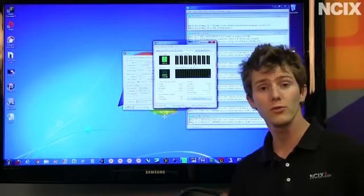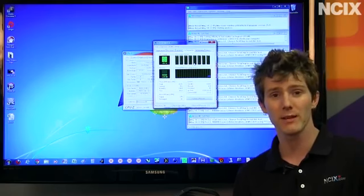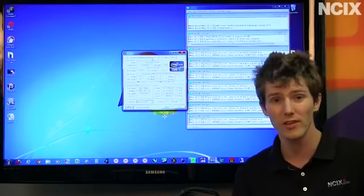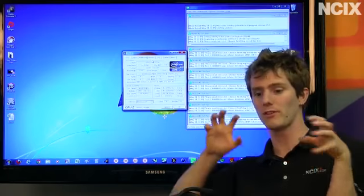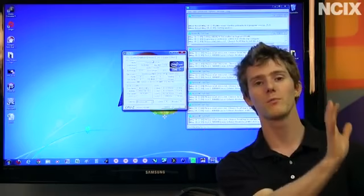There are tools that do stress the CPU more. However, some of those, like LinPack for example, are not really recommended anyway, because they stress your CPU in a way that is even beyond what Intel does to stress them and is completely unrealistic. So there's two schools of thought on that. One is, well, I want to stress it as much as I possibly can to make sure it's as stable as possible. And the other is going for the more realistic approach.